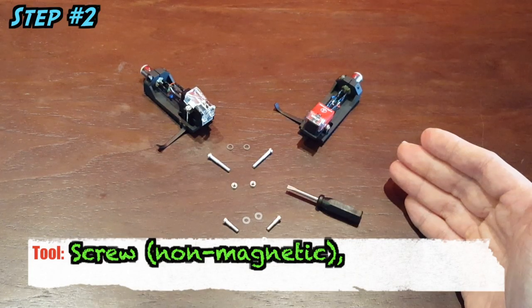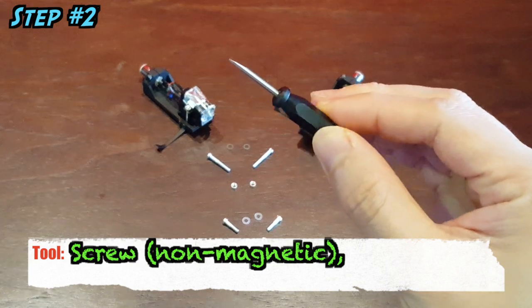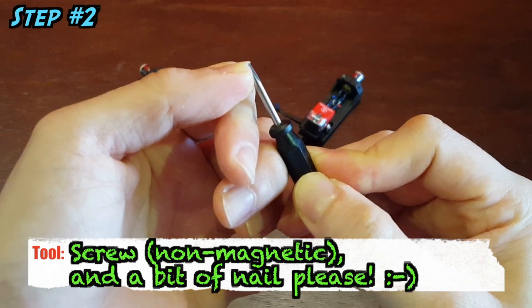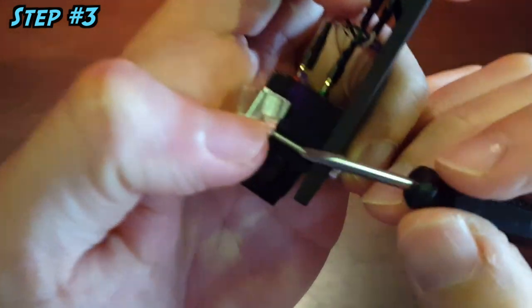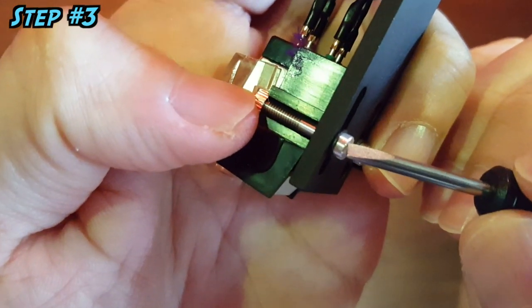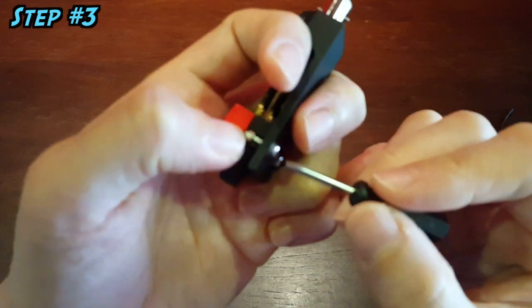Third step: Cartridge fitting. Tool number 1: a good small non-magnetic screwdriver. Tool number 2: your thumbnail — have it 1mm grown and protruding beyond the nail bed. You need it to grip on and tuck into the nick of the bolt and provide the stabilising opposing force while your other hand tightens the screw. Too short a thumbnail, or no thumbnail, and you can't tuck into the nick.